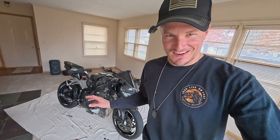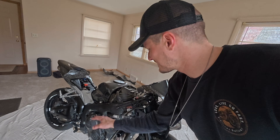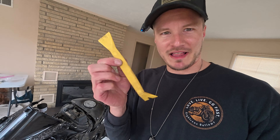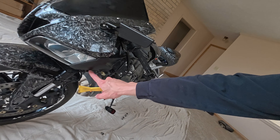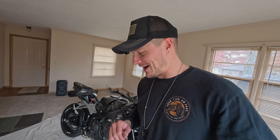All right, we got all the fairings off. Those were really locked in, specifically the little tabs that lock in those upper side fairings to the tank there. Sometimes you just need to get a little plastic pry tool — a straight screwdriver you've got to be really gentle with because you don't want to mar up those plastics, but a plastic tool like this that you can kind of pry helped up by the nose here to get those little tabs out. Everything came out perfectly, we've got parts all around the living room now, no tabs broken. And I knew that's how it would go if I did it inside versus out in the cold.